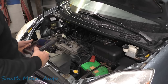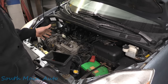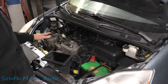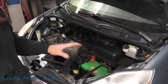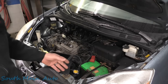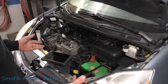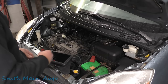We've got a 2007 Toyota Sienna, looks like the big 3.3. Super, super long extended crank to the point where I don't want to crank it right now because the starter should probably be glowing red - cranking and cranking and then bang, it starts. The guy looked at it himself, said he had a cam sensor code. He put a cam sensor in or swapped the cam sensor around with a new one he had and never resolved the issue. So he just brought it here, thinks there might be something wrong with the wiring.